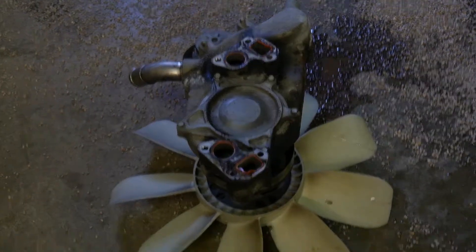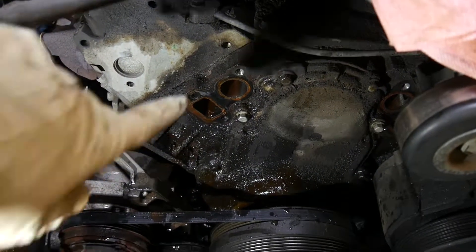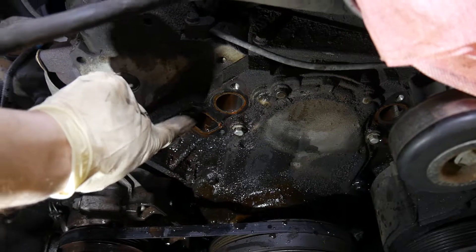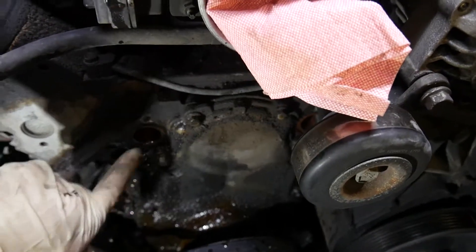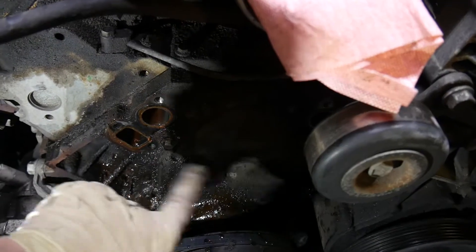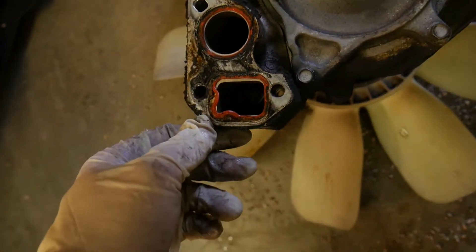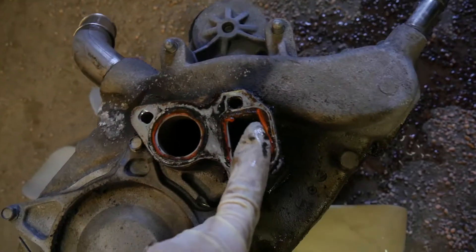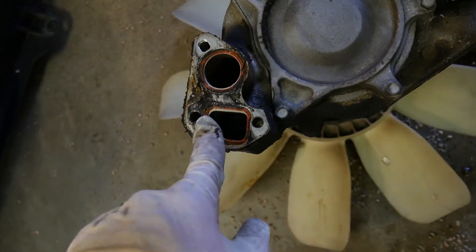There's the water pump out. The fan's still connected, but now we've got to do some clean-up work right in here. We want to get all the gummed-up gaskets off and potentially clean a little bit of this up. It was only six bolts — three for each side in and out of the water pump. You can clearly see here that these gaskets were gone — this one's completely gone — and there's all this gunk built up underneath it too, so it definitely needs to be replaced.